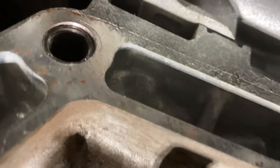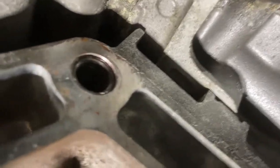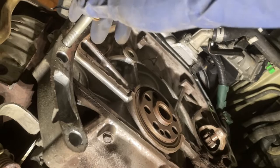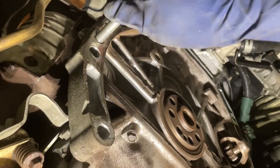Okay guys, this looks good. Get a close-up of the repaired hole here. Look at that. So that's ready to accept the stock bolt, and it's gonna thread in there nicely as long as you follow the torque specs, which I can't stress enough, guys. When you're putting bolts into aluminum threads like this, this is a transmission bolt. They're steel. If you ram these in here with your impact wrench and you keep going, it's gonna start pulling these threads right out of the block.